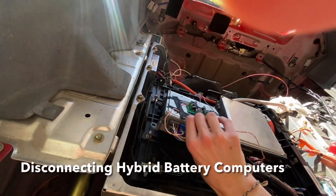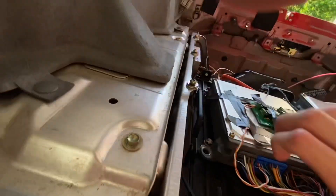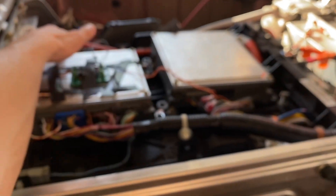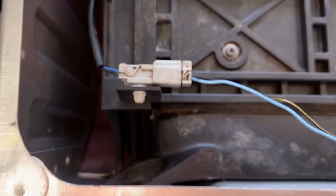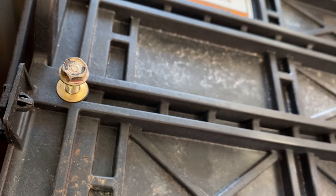You're going to go ahead and disconnect these wires. I've got the thing that holds these in place removed — it's just 10 millimeter screws. You will release these by pulling, pushing the pop tabs up like that. I'll just pull these out of the way since I've already got them removed. You will need to remove this clip right here and remove this sensor — just push that down and pull out. This one should be good to go as well.